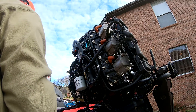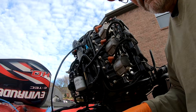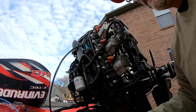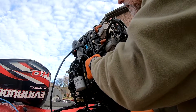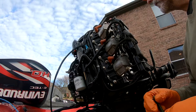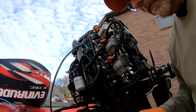Good tight grab. The other hose that broke while I was changing out has just disintegrated — it came apart in about 10 different pieces, very brittle. So that leads me to believe I really need to replace all of these. I'll do as much as I can with the amount of hose I've got, and I may have to order some more. Luckily this other one that broke goes to the top of the engine as well, so it's fairly easy to get to. I also just discovered a small crack in the main line to the manifold, so hopefully I've got enough hose to replace it.